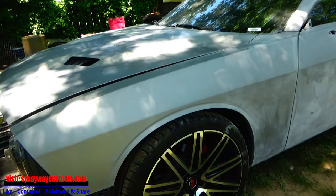I got the front bumper over here. I'm not gonna paint it with the car. I'm gonna paint it separate. But I'm gonna fill these holes up here. And also, there are two spots up here that I seen. It's been repaired before. There's a spot here that's bent down, so I'm gonna put a little glazing putty on it, build it back up on the east side.